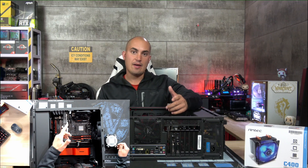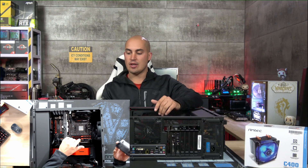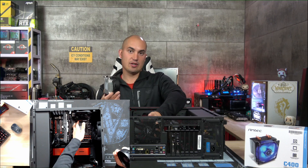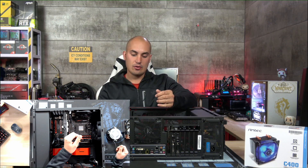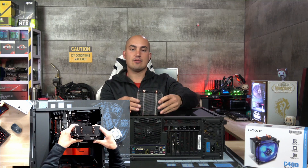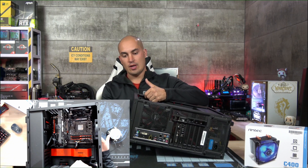Keep in mind that every AMD board is shipped with a bracket installed. So if you need to mount the original cooler, which connects by screws, you have to remove this bracket first. But if you want to use an aftermarket cooler like this one, you don't have to unscrew the mount because it's perfectly compatible. You just have to apply the thermal paste and install the cooler — and in this case you don't even need to remove the back panel.